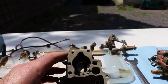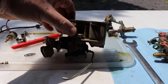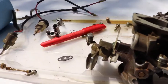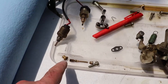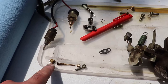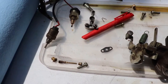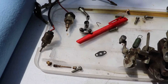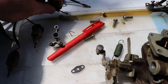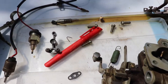The machine has been backfiring a bit, so I wanted to clean the carbon out of the carburetor. There are some jets here that just need to be cleaned out. All you do is use a wire off a bristle brush and just kind of clean it without scratching it. In the manual they say specifically not to do that, but that's the way I do it. I just have to make sure all these little holes are good.